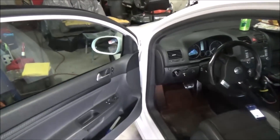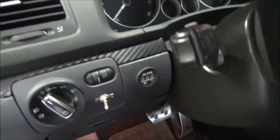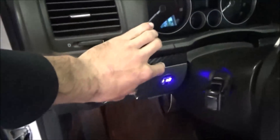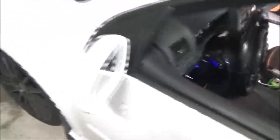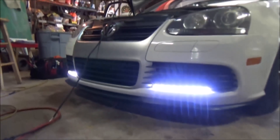Just a little R32 update — I haven't been making too many videos but I still do stuff to it. I put this volt gauge in and did the trim in carbon fiber, because the volt gauge was so bright it mirrored off the door trim, which was kind of annoying. I'll go through that and show you the volt gauge and how I wired it up. It's tapped into the fog light switch, so those come on as well. Pretty happy with that install.